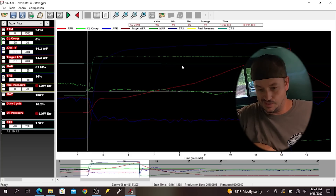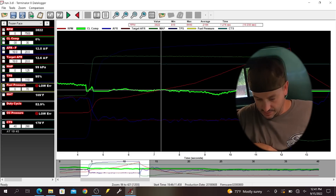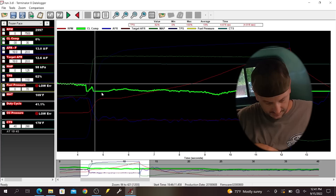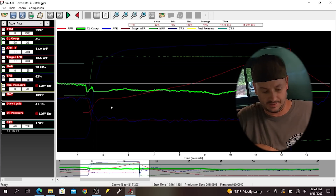I'm more excited about how well it's starting now. I just tried about 20 different things and I think we got that ironed out. Let's take a look at our correction here. I made the closed loop correction bar big and fat so you can see it easily. Just looking at it right away, you can tell that it's a relatively straight line. Scrolling through our log, you can see it's flat and it's at zero. Sometimes when you slack it can make it work better - odds are closed loop is turned off there due to tip-in.